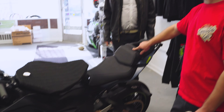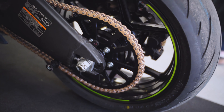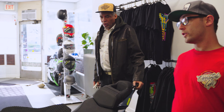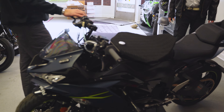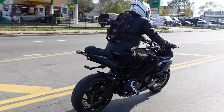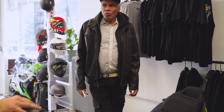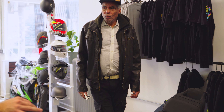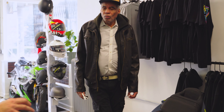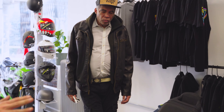You decided on the 55-tooth sprocket instead of the 60 you had mentioned. When you mentioned wanting to do some street riding, some highway riding, getting out once in a while, I would say 55 — that's what I run on my 636. If it was a strict lot bike, 60-tooth would be okay — something you literally pull out of your garage, put into your truck, drive to the parking lot. Since this is going to get on the road here and there, I think 55 is a perfect happy medium.